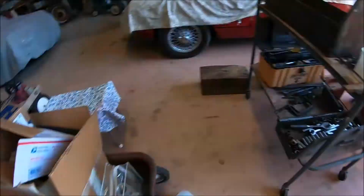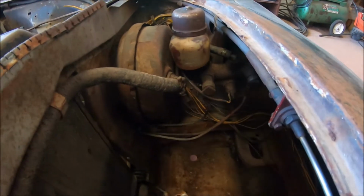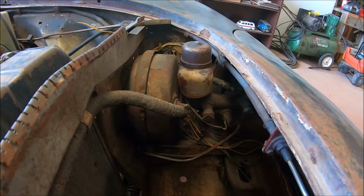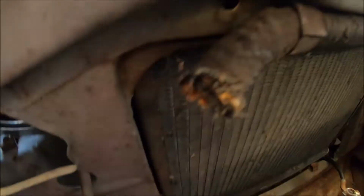It's somewhere, I don't know. Anyways, we got a new one. We got a big brake booster. It's a 9-inch and a 22mm master cylinder versus the 20mm original one off Opel GT Source. So that's pretty awesome. Can't wait to do that. So we'll actually have power brakes now instead of no power brakes.